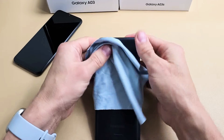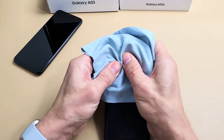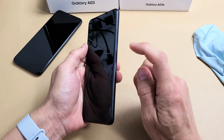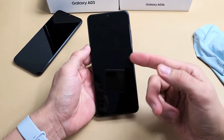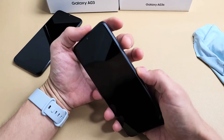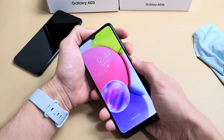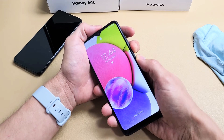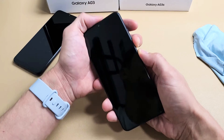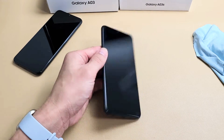Do the same thing on the back side — two thumbs, press all over, and also around the lens. If you hear a little click around the lens, turn your phone over and wait to see if you're out of the boot loop. You can use a cloth to avoid smudging the camera lens. Then turn the phone over, tap the power button, and see if you're still stuck. If you still are, Volume Down and Power — press and hold until you see the Samsung logo, then let go.